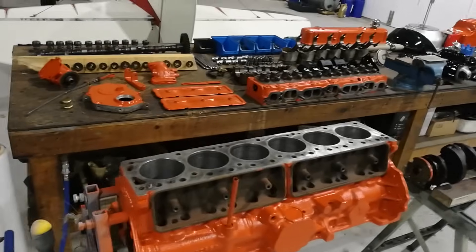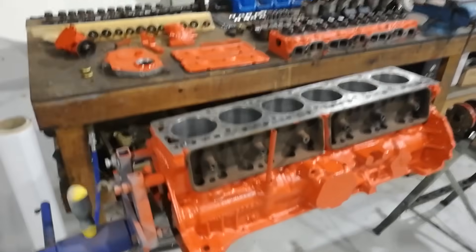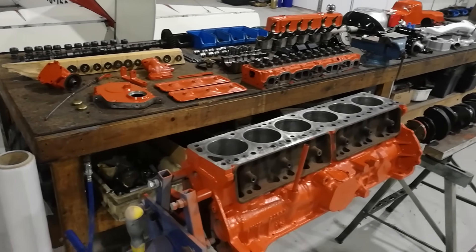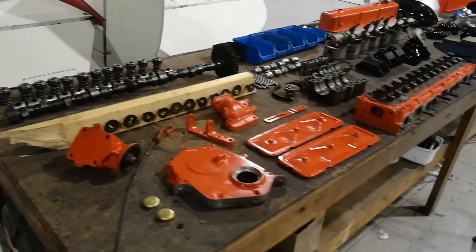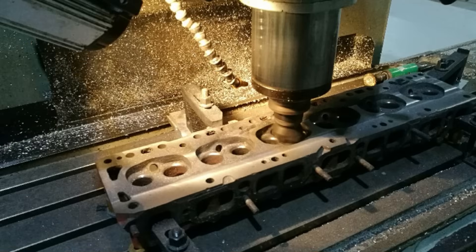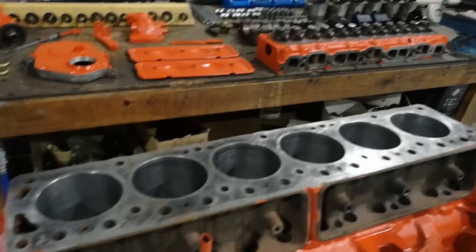This is virtually a show engine now, but I just couldn't help myself. I took the rocker cover off, thought let's have a look at the valves - it was pretty cruddy in there. I thought I'll give that a clean up, and before I knew it I'd torn the entire engine apart and literally serviced everything. I'm glad I did take the engine apart because it had a couple of problems - it had a distorted cylinder head with about a 0.3 millimetre bow in it, so I was able to mill that out. In fact it was leaking water into the number five cylinder, so it was good to fix that.